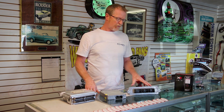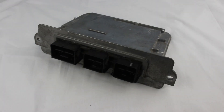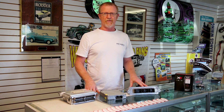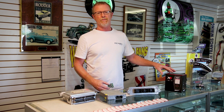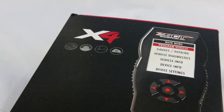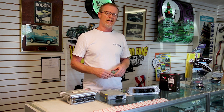Ford's newer ECM, which would be this one right here, was typically used 2005 and up and it is for applications that had drive-by-wire. These ECMs do not have a port to install one of those piggyback chips on, so we have to go with a full reprogramming. On the Ford we can provide a programming device that will reprogram the computer, and it also has additional features such as adjusting gear ratio and tire size yourself, putting a slightly more aggressive spark advance in there, as well as reading any trouble codes.